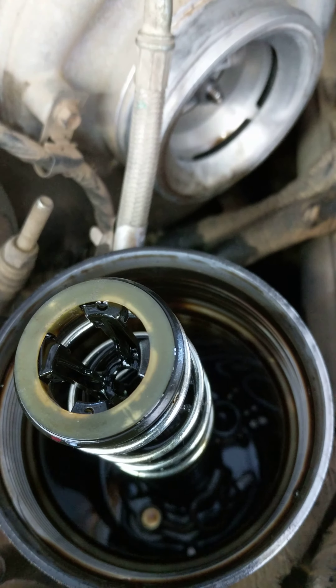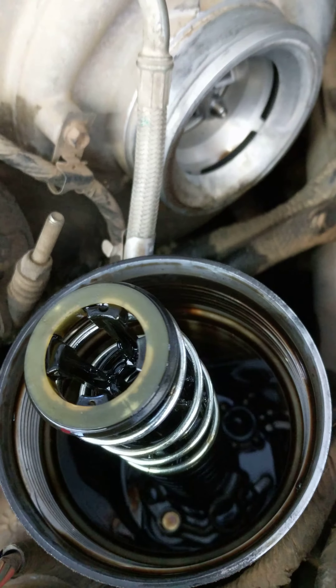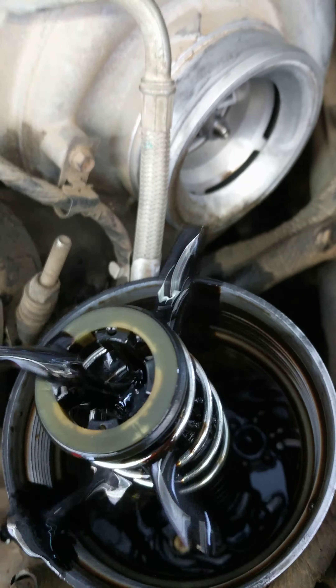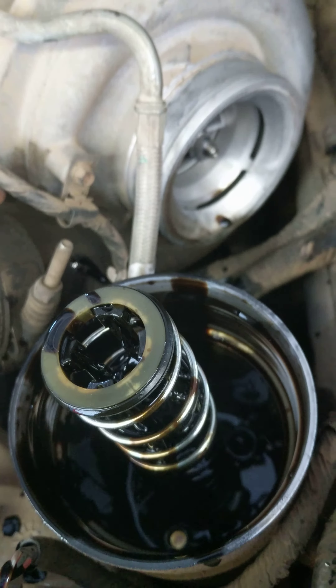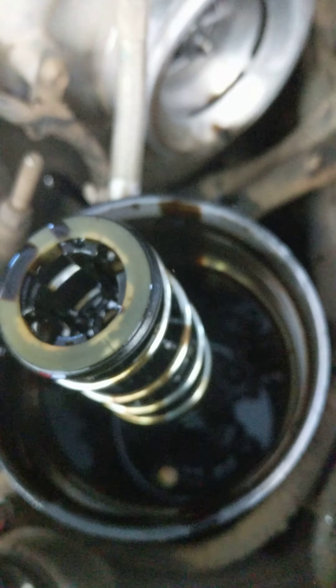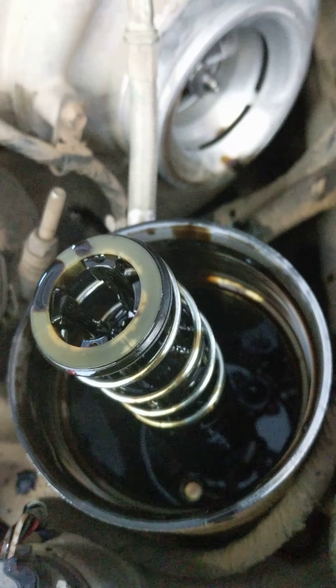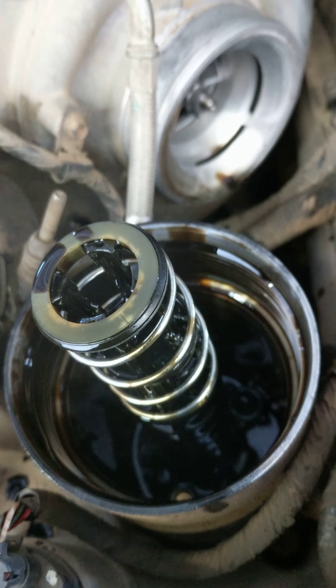Look in here, you got to bend it and go under. You see it's shooting oil out of the oil filter, back feeding pressure through the pump into the oil system backwards. You can hear it gurgling too.